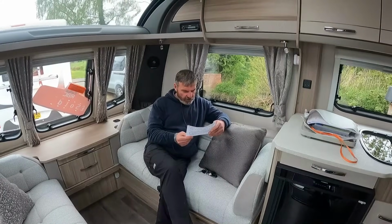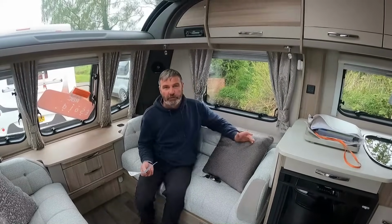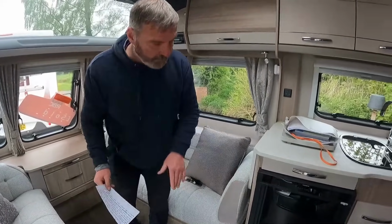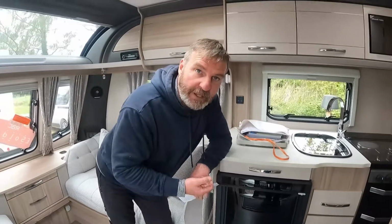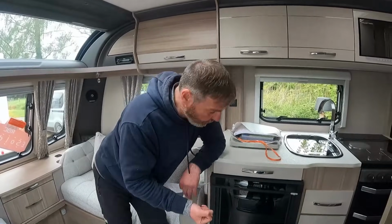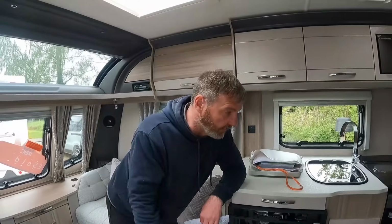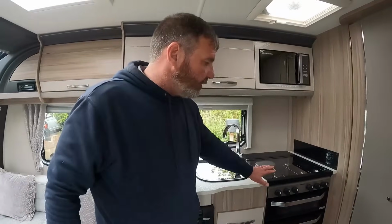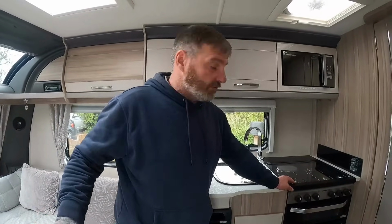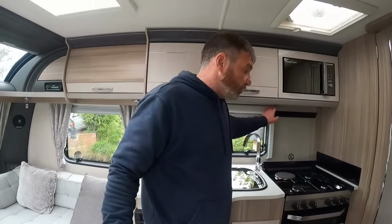Tommy and Ballers Adventures, what appliances can you use off-grid? So the reason why caravans and motorhomes are designed with gas and electric, let's take the humble fridge, what's known as a three-way. You can either use the electric if you've got a hookup, but if you're off-grid, you won't have electric hookup in the van, so you would have to use the gas. A lot of the vans now are starting to go to compressor, which run off the leisure battery. The reason why all the appliances have gas is because then if you're out wild camping, you can use the gas. But again, the hot plate you couldn't use because that's electric.